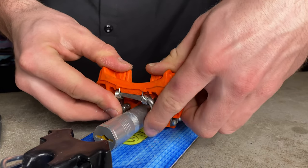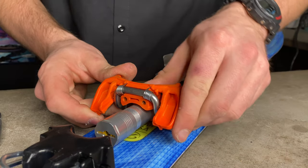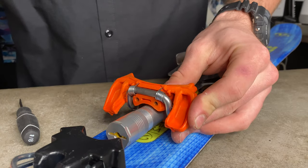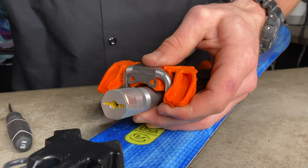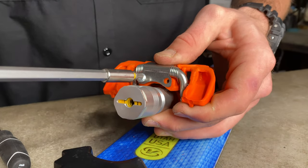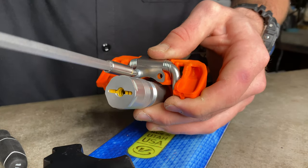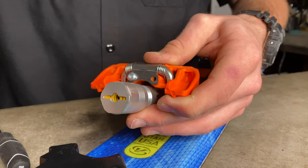As we do this, we're gonna push down and back. That'll keep the springs seated where they're supposed to, as well as letting us twist this claw back. Then we'll take our claw clip, hold that down, take our screw, and put it back in. Now with a new claw we're gonna be cutting threads into this, so just be a little careful. We are going into plastic, so we just want to make sure we don't over-torque these and strip the threads.